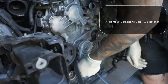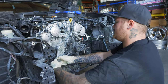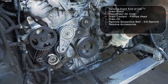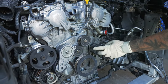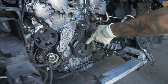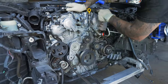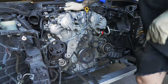We are pulling the serpentine belt off right now and we're going to start pulling the front part of the motor apart. When you get to this point the first thing you want to do is put a three-eighths ratchet inside the tensioner and loosen that up, then take the tensioner off, pull the power steering pulley off, pull the alternator off, pull the AC compressor off, pull these off, then pull this one off. We will then drain the oil pan, unbolt the oil pan — there are two 12mils that go up through the oil pan, take those off first — then go around and unbolt all these 10mils, unplug everything, take the water pipe out, and then the front timing will be showing.